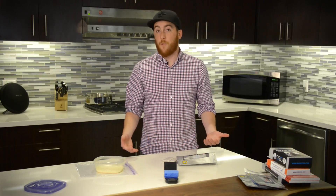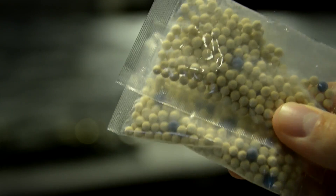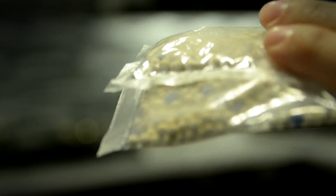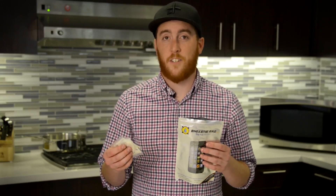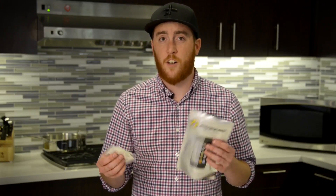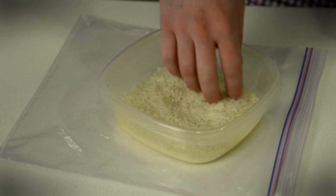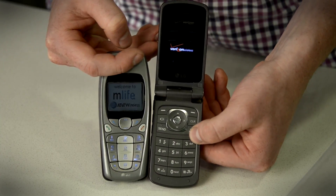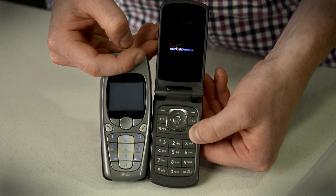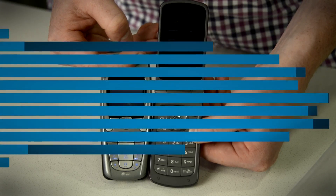After running through our experiments, we basically proved that both of these methods work just fine. Technically speaking, the silica beads in the Beastie bag worked a little bit better — they pulled out a little more water. We'll give them a few extra points because it's easy, convenient, and you can tuck one away in a glove box. But truth be told, if you don't have one around, rice will work just fine. Good news for our antique phones: another 48 hours of drying time actually brought them both back to life. So if your device is ever caught in a watery situation, hopefully these steps will help revive it.